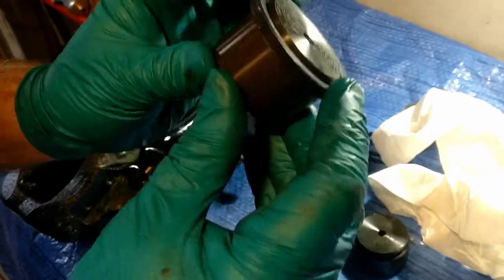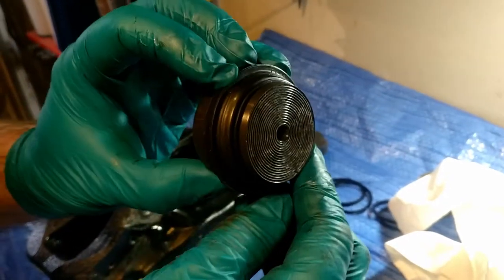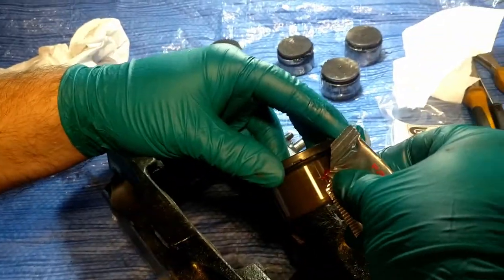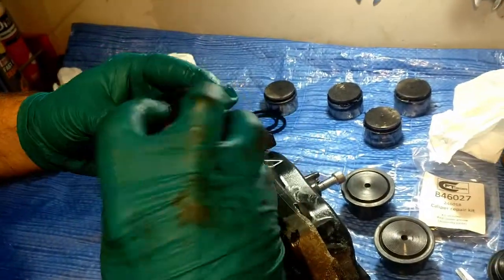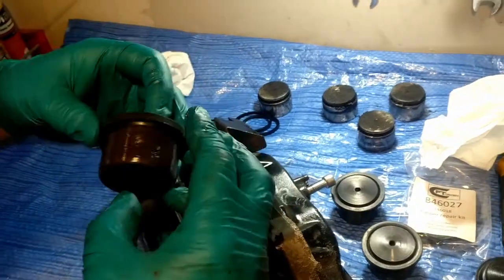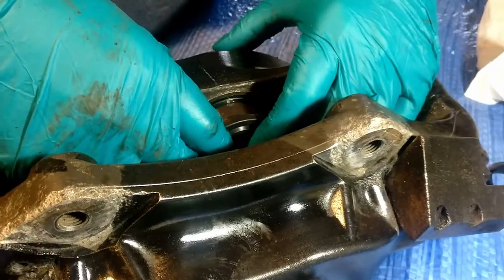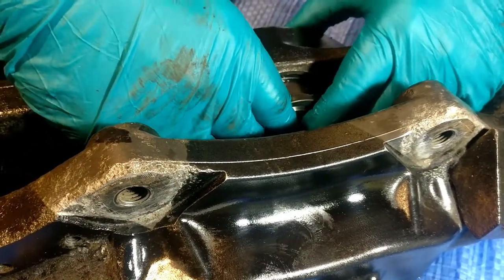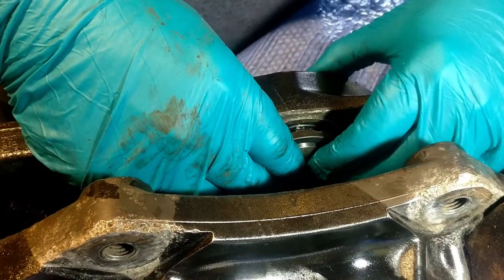So that goes like that, and you can see when the piston's going to come out, it'll do that. And the rubber's in the recess. And that's two done. Right, so a tiny bit of red rubber grease again. Give it a wee smear all round. So you take your piston, put it in, and the secret here is put it in square. Now I'm using no effort whatsoever here, and it's sliding in. Very, very little effort.